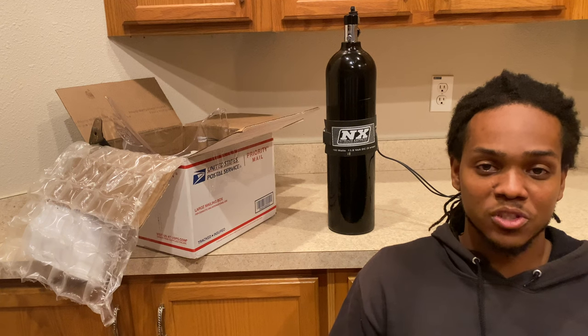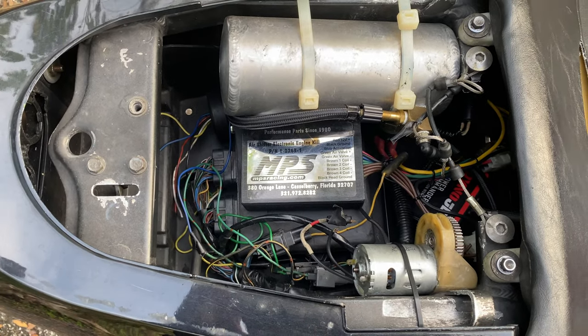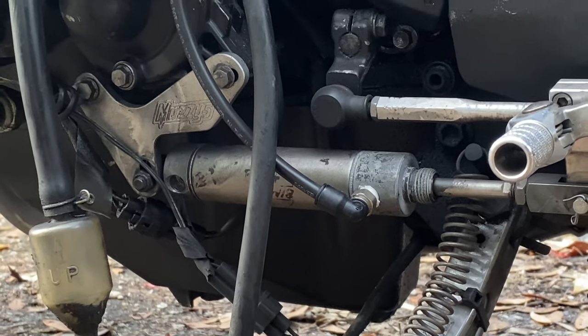One more thing I would say is an air shifter is probably gonna be the final touch on your build after you've done an exhaust, an air filter, velocity stacks, flash the ECU, got a piggyback tuner, actually ran a dyno tune on your bike, you've stretched and lowered it, you've changed the gearing to your specific application. An air shifter, basically, you have an air tank and a compressor, an onboard compressor. So your onboard compressor fills the tank and goes to an air solenoid that is connected to an air cylinder that is connected to your shift lever.